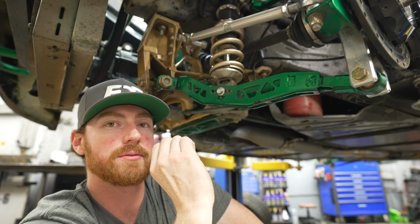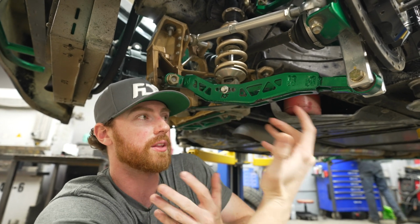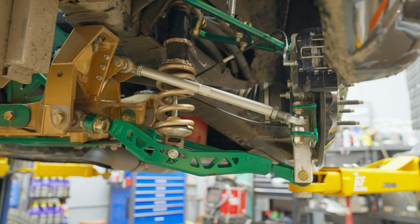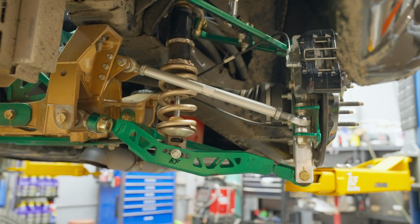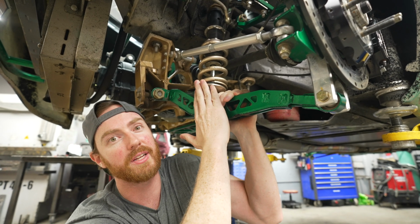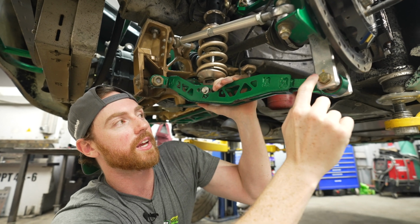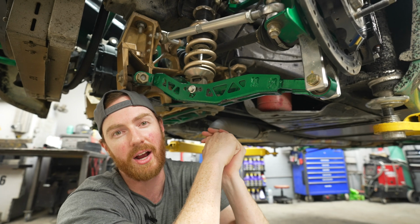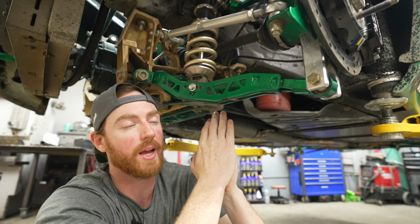The grip kit that will be available will not be this lower, unless of course you specify it, but what I did with my motion ratio and how I mounted the top of my coilover, most people are not going to be willing to do that. This is actually a front coilover specifically made to my specifications, mounted in the rear so that I could get a motion ratio in order to get around 6.5 inches of travel in the rear. Factory suspension only gets around 4 to 4.5.